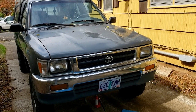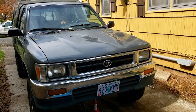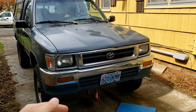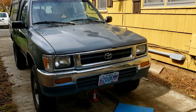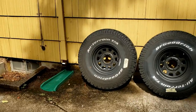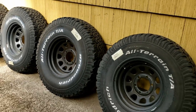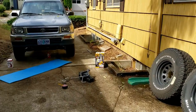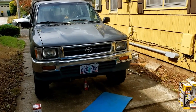There are also miscellaneous reasons. Your speedometer is going to be inaccurate with bigger wheels and tires. You can get around that by buying a different gear setup for the speedo drive that connects to the transmission, but those aren't really available for this pickup truck. And of course, with big heavy wheels and tires, your gas mileage is going to go down. For me, it's strictly a performance thing.